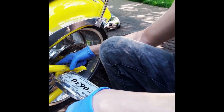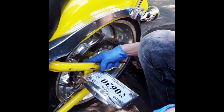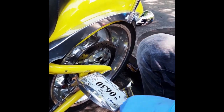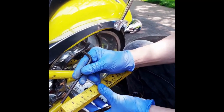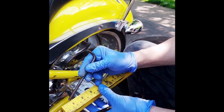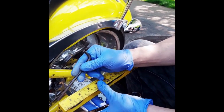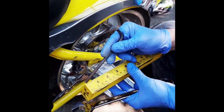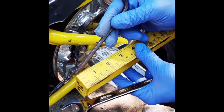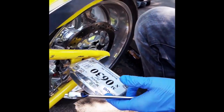It's almost impossible to see in here when the pad is worn down. You're supposed to change it when it gets below an eighth of an inch, and some people push it down to about a sixteenth of an inch. But that's your general amount — once it starts going below that eighth of an inch, you want to start changing it.